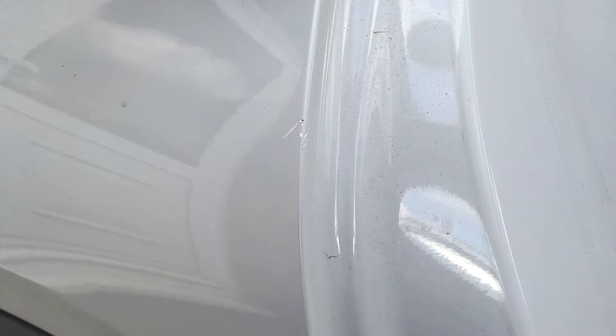You can see this damage here is a lot more deeper and larger. We're going to carry out the same method of repair that we just did on the stone chips. It's not going to be 100% gone, but we're trying to minimize how much you can see — that's what ChipX is trying to do. No paint repair will be fully invisible; you'd need a full paint job for that. We're just trying to make it less noticeable. It looks a lot better now — it is very deep, so it's a lot less noticeable. I feel like if I spent a couple more hours on it I could completely get rid of it, but it's very minimally noticeable now especially when the door's closed. This area is a bit deeper so it probably needs a little more coating.